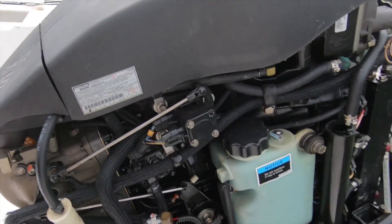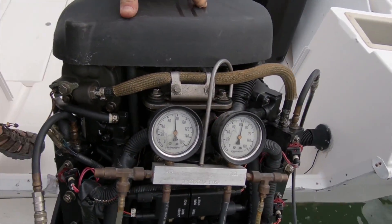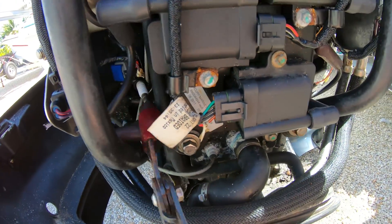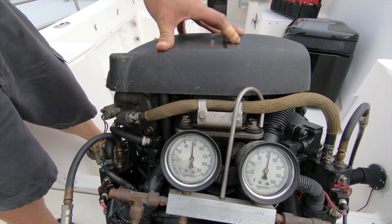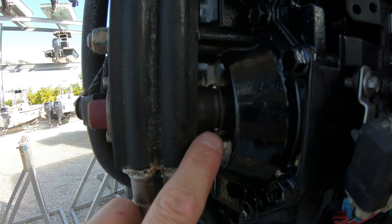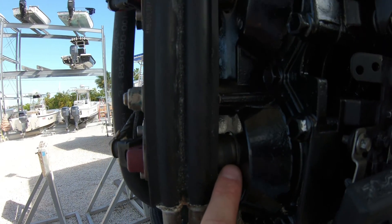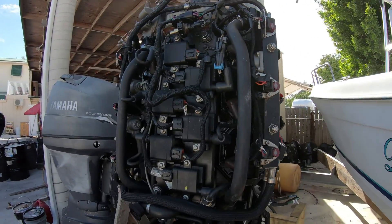If you are trying to test this in your driveway, another test to perform is a drop test. Do this with the engine running and disconnecting a spark plug wire to determine which cylinder is not firing. You will hear and see the engine stutter when you do. If nothing changes, there's an issue with that cylinder. If you are suspecting an injector, remember that both of them are super expensive, so you can try swapping a suspect one with one of the others that are on that same fuel rail.